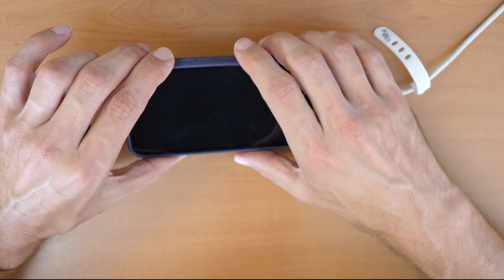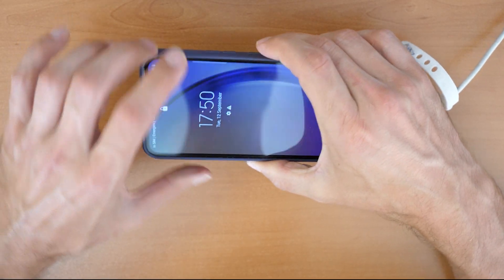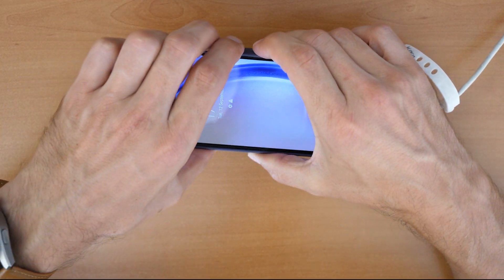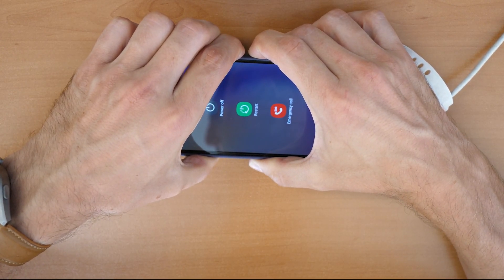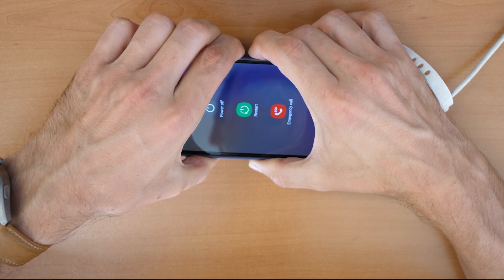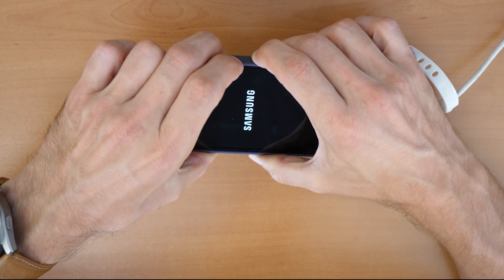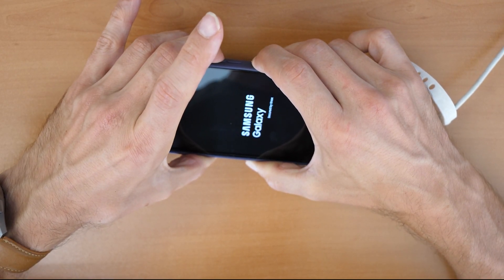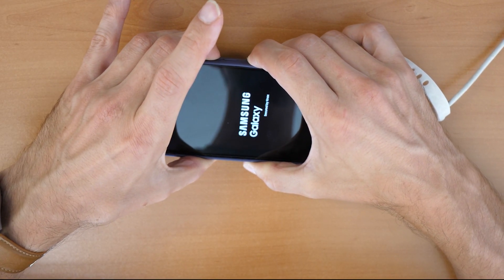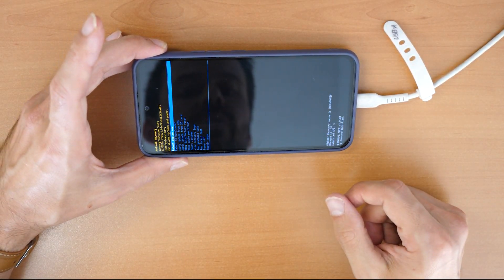Let's go and try. Click on all three buttons — first click to wake the screen and then click and hold all three buttons. You will see a menu; just keep holding the buttons. The phone restarted. Release the volume down button but keep holding volume up and the power button. Just keep holding these two buttons and there we go — we came into the recovery menu.